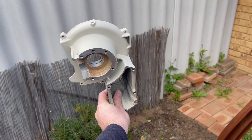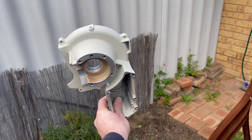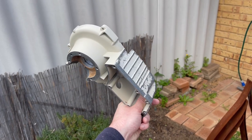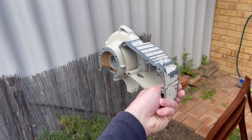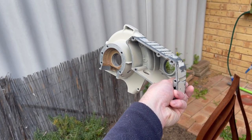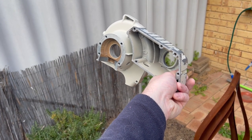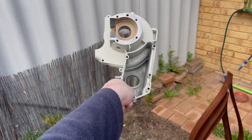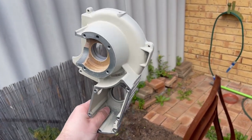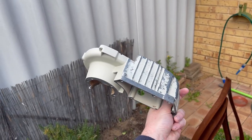And one thing that you didn't see was that I did another coat, but a very light dusting coat, and I kept the spray can a bit further away from the workpiece. And what that allowed is basically it to dry just slightly before it touches, and that removes the shine. You might have seen there was quite a lot of shine beforehand, and I could have sanded that off, but I actually prefer this. Again, no horrible harsh transitions. I only did that section up to that point, and I think it's a very good repair.